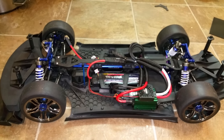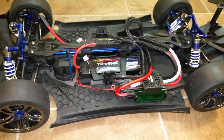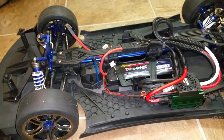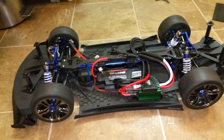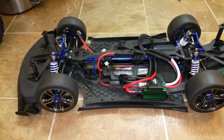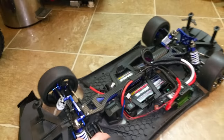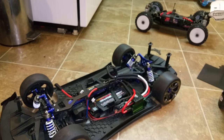I know MT Tookie's got a very similar setup. This stuff was going to go in Rusty, but I'm having some problems with the rear toe on my Rustler with the Jato arms. If any of you guys know of a bearing carrier with a 3.5 degree toe-in that I can find — the only one I could find was for an X01 and that doesn't work with my axles. So that's sort of on the side for now. If you guys can help me get some toe-in on that thing, because it's toed out right now with the aluminum Traxxas bearing carriers — axle carriers — it's super annoying.